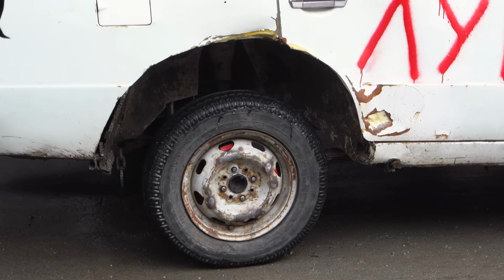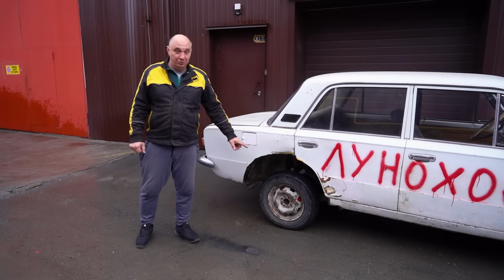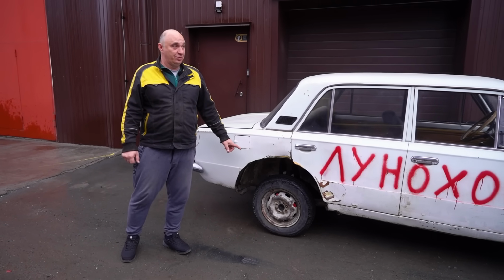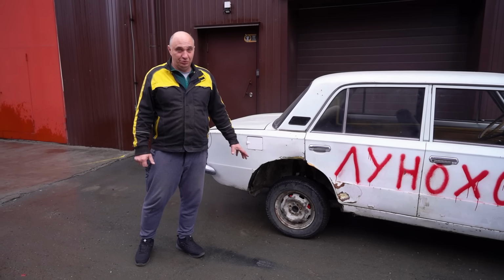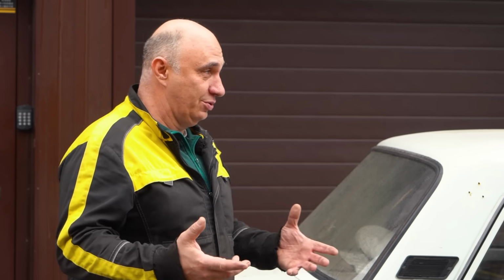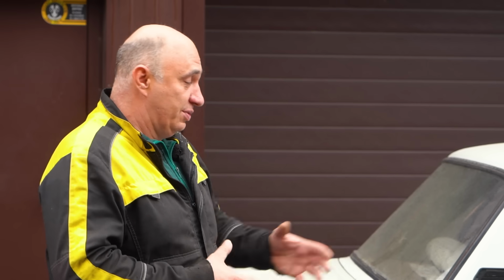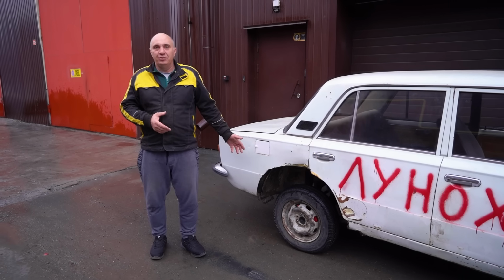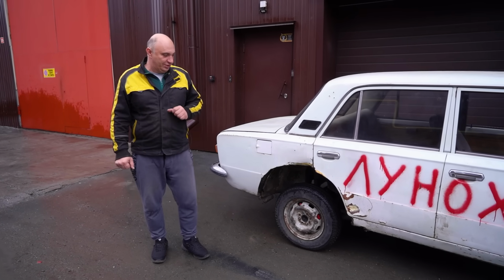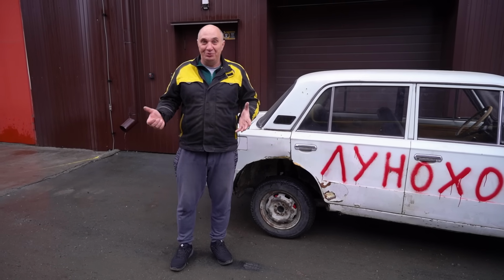I mean, we saw wheel spin, we did some driving, and you would have seen me turn at various speeds, and given that this is fitted with a welded diff, the wheels are experiencing quite a bit more stress, as they're rotating at the same speed all the time. The radiuses were all different, and this severely increases the load on the driveline and on the wheels. But the mechanism held up just fine. Those four latches coped with enormous stress, just as four bolts would have, though they do get ripped out sometimes, but hey. But at the end of the day, this worked, this was great.